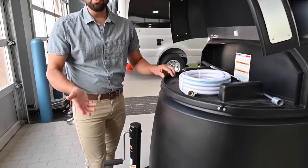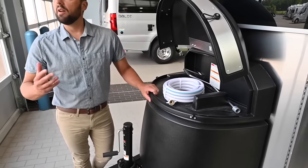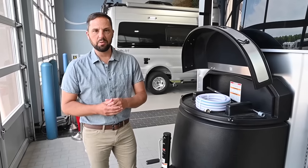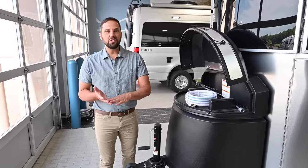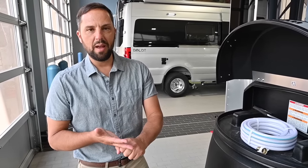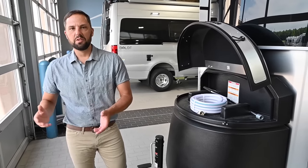This is a 3,500 pound gross vehicle weight rating trailer with an over 400 pound hitch weight, so make sure your vehicle has a maximum towing capacity of 3,500 pounds or more and can handle the hitch weight and additional payload. Every vehicle has a gross vehicle weight rating and a curb weight — the difference is your net carrying capacity. Factor in your passengers, luggage, cargo, accessories, and the hitch weight of the trailer. You cannot exceed your vehicle's cargo carrying capacity. The three things to check when buying a tow vehicle: towing capacity, hitch weight capacity, and cargo carrying capacity.